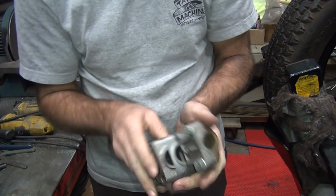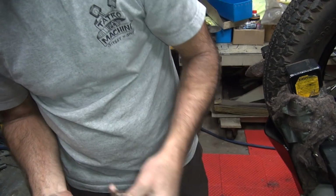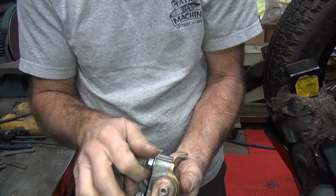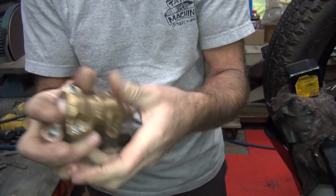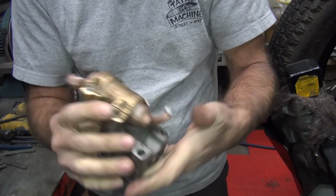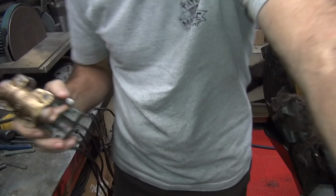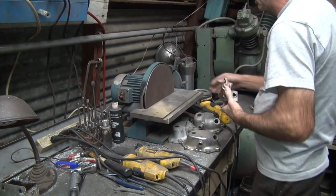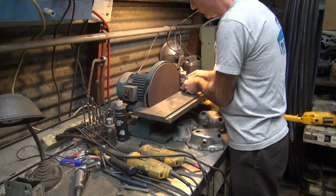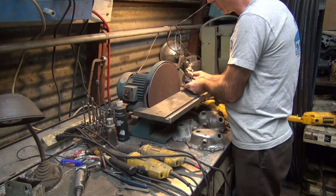So we get our grinding fixture here. Just held together with a couple bolts here. Pull that out. Bolts together like this. So you rotate all the way until you hit the stop right there. Tighten the bolts down just finger tight. And this will hold it now so you can actually grind it on the grinder. You can see how the grinder gets in here tight, so it'll work. Now this has to be ground on the grinder over there. It'll be on the far side over here. Light over here. So do a little slip in there to see what you got, the right angle.